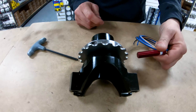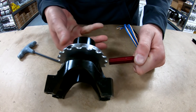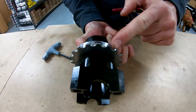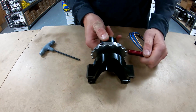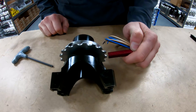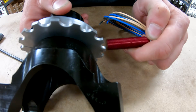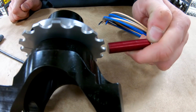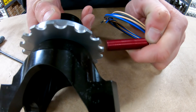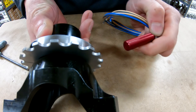This is the same style setup used on crank sensors — gear-tooth style crank sensors. The sensor is just looking for the high spots and the low spots; the gap at the bottom doesn't matter because once it gets past that tooth it's at a low spot waiting for the next tooth. One big thing to take into account is making sure the sensor is lined up so that the tooth is in the middle of the sensor. If it's cheated off to the side it'll miss part of the sensor. It also needs to be square and perpendicular to the actual tooth — if it's pitched it's not going to get a good reading.